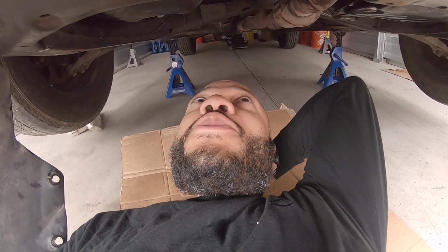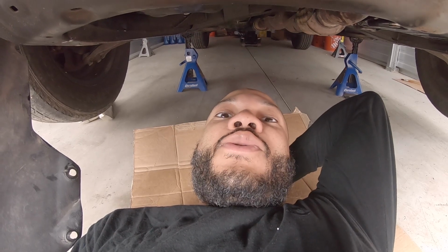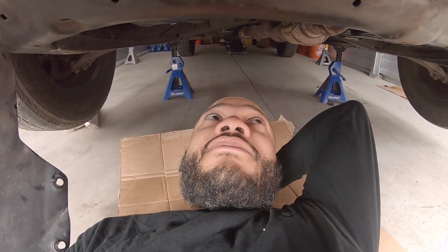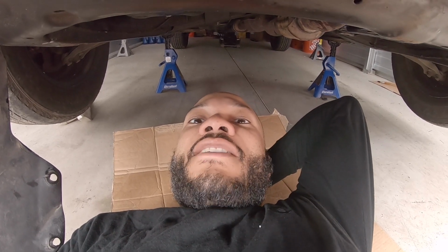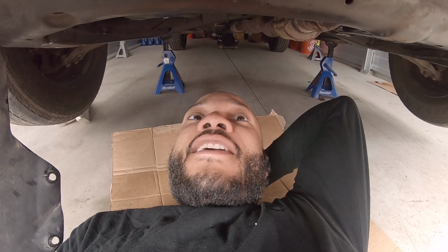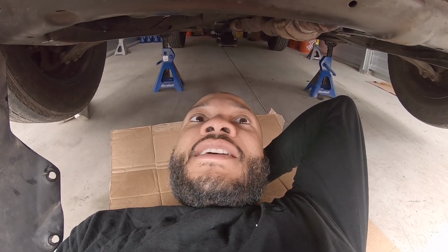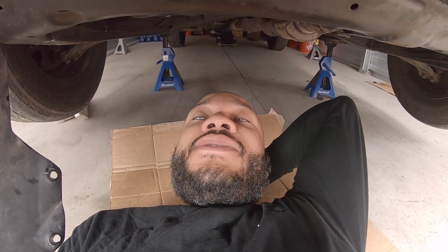But the oil pan is straightforward. Unbolt it, clean it up, of course get all the old gasket maker off, re-seal it, and make sure you get everything cleaned and prepped for the sealant. Read the instructions for your sealant. Some have you clamp it down for a little bit, then wait, and then clamp it again. But we don't. I'm using Yama Bond. That's just what I use.